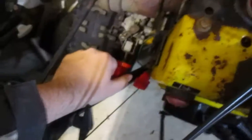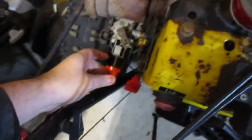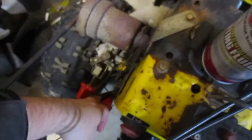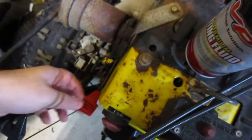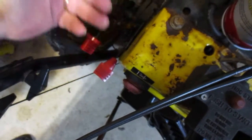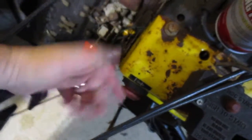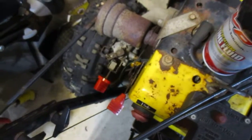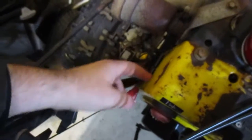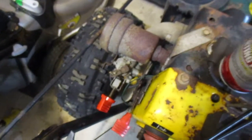Let me see what the choke is doing here. The carburetor's got some rust in it too. Choke is open. I'm gonna throttle up a little bit here — midway. No sense in hitting the primer because there's no fuel in the tank and it's rotten anyway, so the fuel line is rotten. Plus I've gotta figure out how to make this switch ground out again. The ground-out tab is broken on it so it doesn't shut off — probably good there's no gas in the tank. Just on starting fluid.